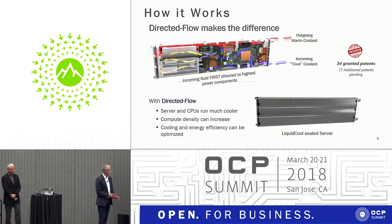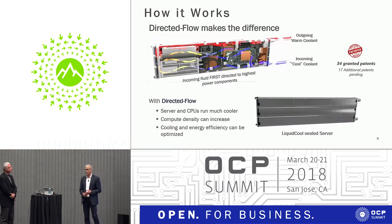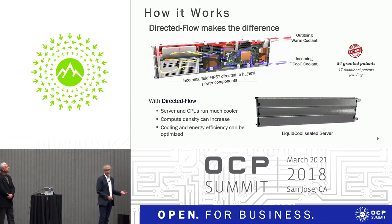This particular design is a two-socketed design. We've had it roughly about seven years now — we've gone from the first Xeon up to the current Xeon v4, and now we have to navigate onto the Skylake instance. It's very effective. It's one of the tools we've used with research firms and gotten a lot of feedback from NREL and other government bodies and universities around the effectiveness of cooling. With this solution, we've been demonstrated to deliver a PUE of 1.02 at the total solution level.